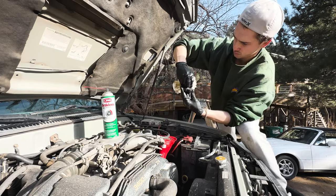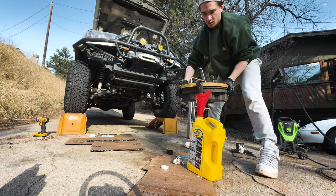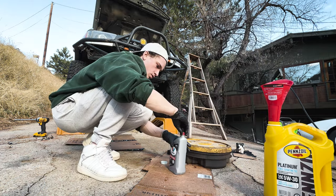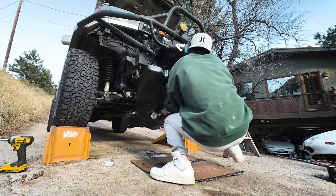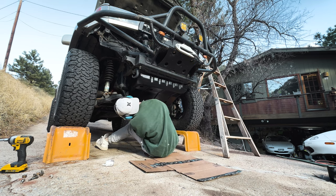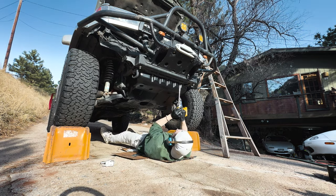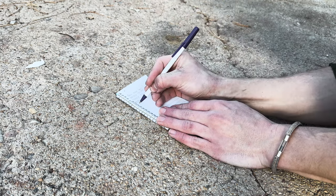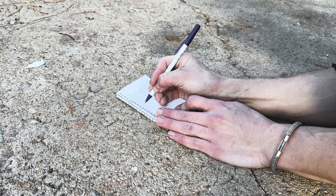While we're at it, I'm just going to clean up the cap real quick, swap it out for the funnel, and check out how nice it looks in the engine bay. Before we put those skid plates back on, I'm just going to pour the old oil back into one of these big 5-quart containers. If you have any extra unused oil, I'm going to pour that into one of these small 1-quart containers — I always like to keep one in the vehicle at all times in case of emergency. Finally, we can go back to installing our brand new looking skid plate. I always like to mount this with the front on first — it has these three little hooks so it'll kind of hold itself there, then I'll install one of the rearmost bolts first. I like to keep a logbook of all the maintenance items I do to this truck, so I'm going to quickly write that in with the date, the filter, and the type of oil I use. That's super nice to look back on, as well as for any future owners if I ever decide to sell this truck.